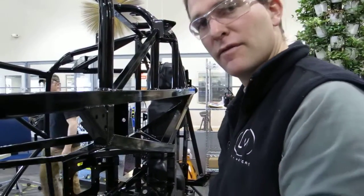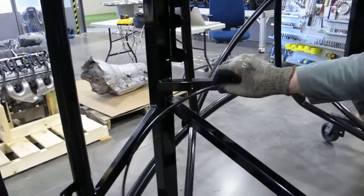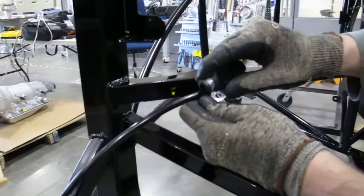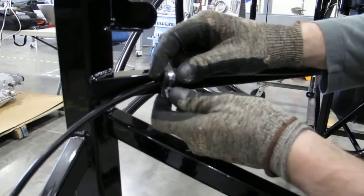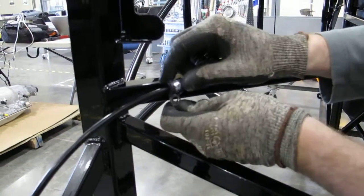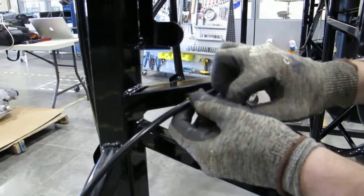We're putting in our final insulated clip for the fuel evap line. I take my insulated clip and move toward the top of the vehicle as it's twisted and rotated. I put the insulated clip over with the flush side facing the tube and squeeze it together as usual. See my mark right here?